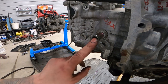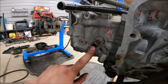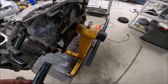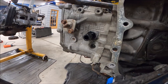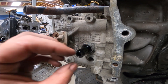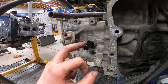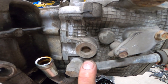One other thing: the 20X always comes with a cooling port — you might call it a cylinder 4 cooling mod — they come factory on these engines. On his engine he had a cylinder 4 cooling mod, so we'll take that off, get a clamp, and put it back on there. If you don't want to do the cylinder 4 cooling mod, it only entails a water hose from here to the outermost heater core line with a plastic T-fitting. Take out this fitting on your engine — if you didn't have a cylinder 4 cooling mod, you will actually have a plug right here that will fit into the EJ20X, same style as that plug. You can take it out and fill the hole if you want.